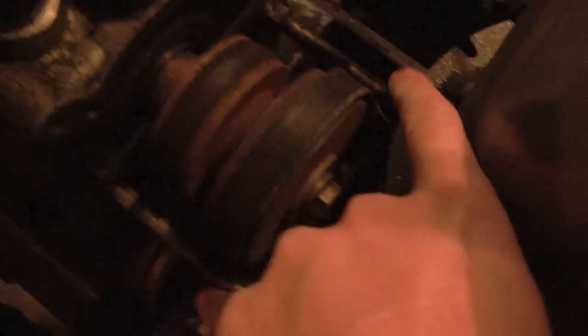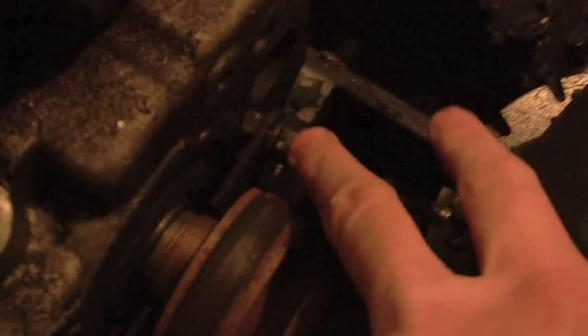One thing that's going to make your life a lot easier — you've got these two posts here that just kind of stay in place and hold the belt in. You want to go in and loosen the outside nut. That will allow this to slip out and then you can get your belt off. The same on the other side — it doesn't seem to move as much, but it will give me enough room to get the belt off there as well.